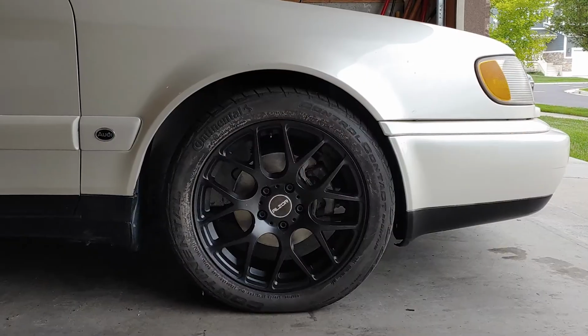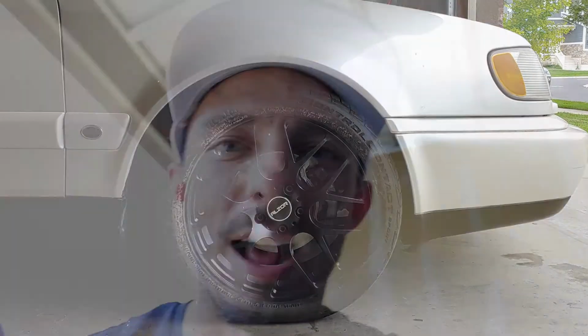Normally that's not a problem, depending on how the suspension is designed, but these control arms are very easy to get backwards, as they only have a slight bend. But long story short, these control arms aren't marked, and so after we took them out of the box, it was a 50-50 shot as to if they were correct, and they're not, because the front axle was sitting forward by about 1.5 inches.